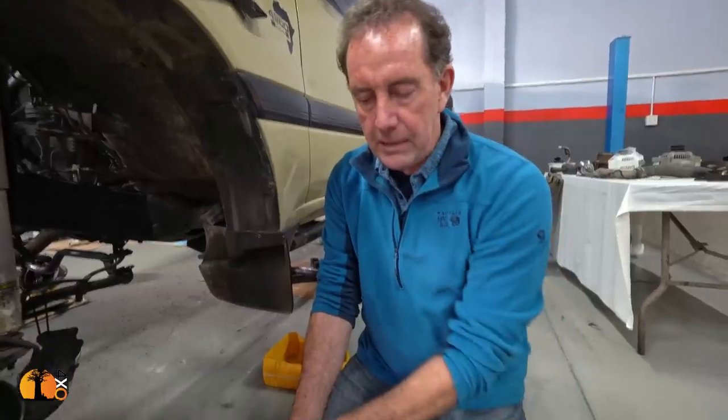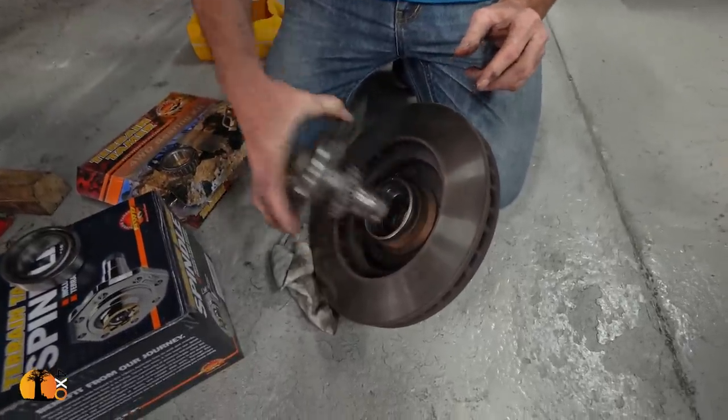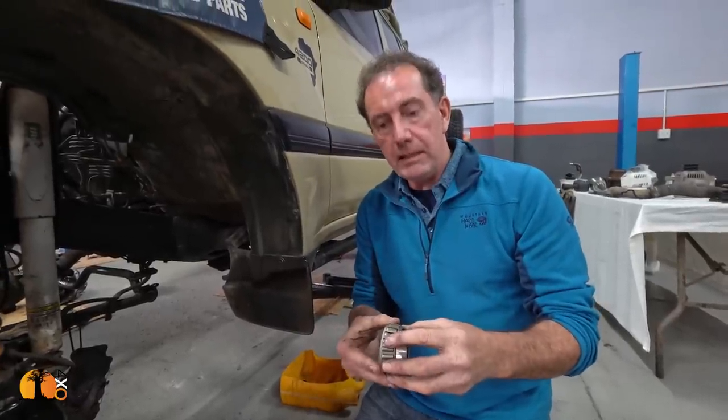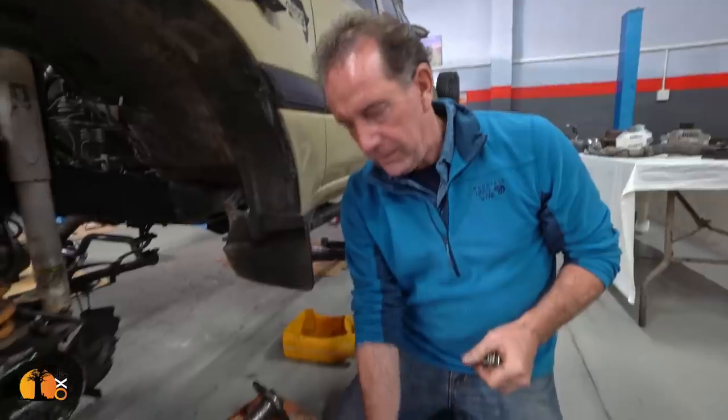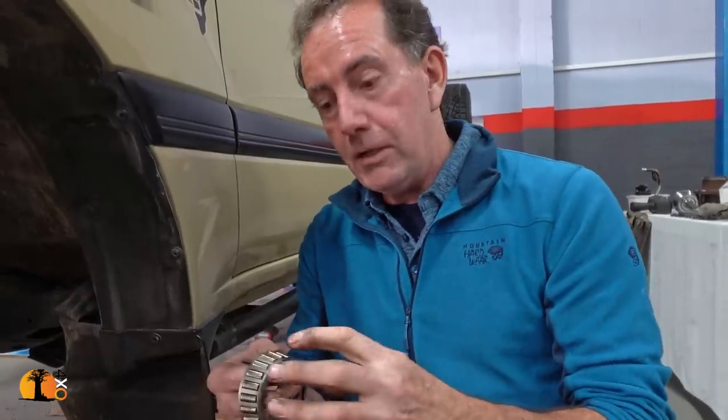What you'll notice here — this is what we recognize as a brake disc; the wheel goes on here, that's where the bearing sits, and then we've got the stub axle which goes in. If you take a bearing out, a bearing is a matched pair — once they start wearing in, they become a matched pair. If you take these as a spare set, I knock out the shell and keep them together; I don't mix them up, because you can't take a worn bearing with a different shell. They've got a nice relationship — they've worked together for a long time. Keep the shell and the actual bearing together if you're going to take it as a spare. And yes, take a set of bearings as a spare, because you never know when a bearing could give a problem. I always take new seals — never compromise on seals; we use the best seals we can buy.